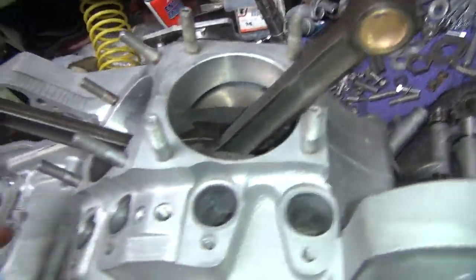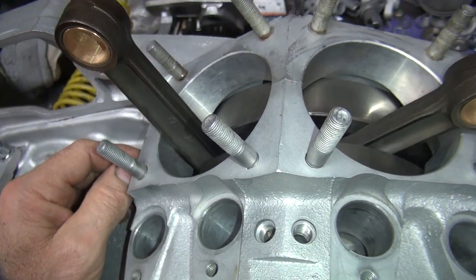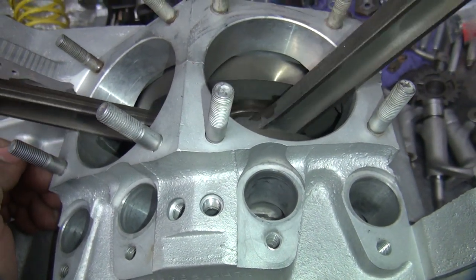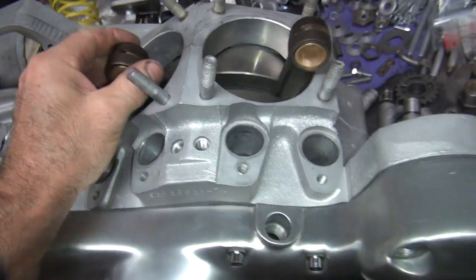Now, we're waiting to see acceptable drag versus not acceptable drag. If the flywheels return, it's acceptable drag. If the flywheels will not return, it's getting a little heavy. If you can barely move it, it's way too much. So that's what we're looking to see right there. Looks nice and free.